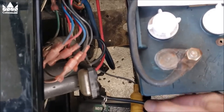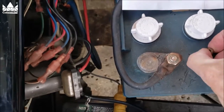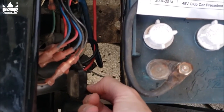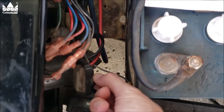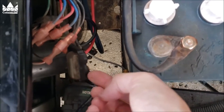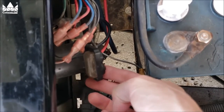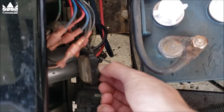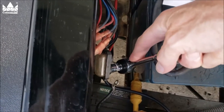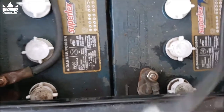I'm doing this one-handed. Let's put our cable on there like that, get this little washer in there — try not to drop it. There's a little notch on the back side where that cable wants to hang down at the bottom, so make sure you have it in that little notch in the plastic housing. Get a good snug with the ratchet, and we've got that done.